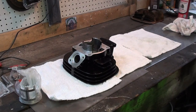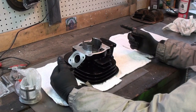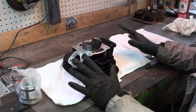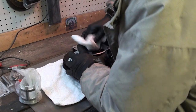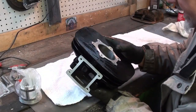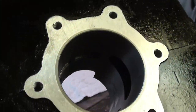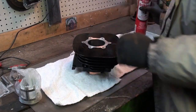Alright, now it looks like we're going to have to transfer some stuff from the old cylinder — like the flange that bolts onto the exhaust. We'll need to move the reed cage and all that stuff. But first, let's clean this thing off because it's already filthy. Let's look at the bore on it and make sure that looks good. Ooh, yeah — nice and shiny, nice crosshatch on there. Woohoo! This is going to be nice. I'm going to clean all this stuff up and I'll get back with you.